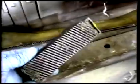And there you have it. As you can see, we put on our first layer of Bondo, and it's coming along with the body line. So now we'll use a cheese grater before it totally sets. That's this tool here. Grind it, shape it, and then we'll put another coat on of the Bondo.